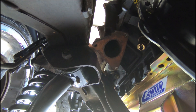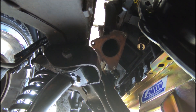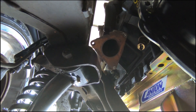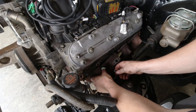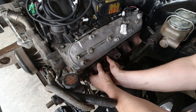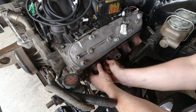This is the '98-to-'02 Camaro F-body manifold. Some of the later ones are a little different regarding the EGR in the top of the manifold, but for the most part any of them in that generation fit very well with the frame mounts and LS adapters we talked about. The F-body manifold is certainly the way to go and works out really well with this combination.